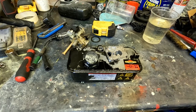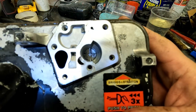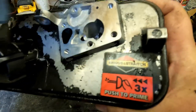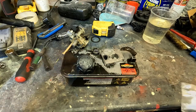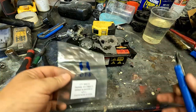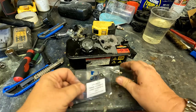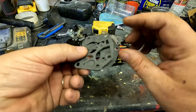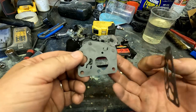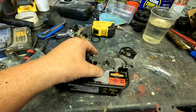I'll take that outside and blow this out again with the airline and you'll see the difference. Right, I've also blown out the tank in case there's any residue in there. Can you see how clean that is in there now? That's what you're looking for. I've also blown down these chambers and that little hole there - all ready to go back on. I've got replacement gaskets here. I normally buy the Briggs stuff but I did these by mistake - they're supposed to be a direct replacement, made in China, but I'm going to try them anyway.